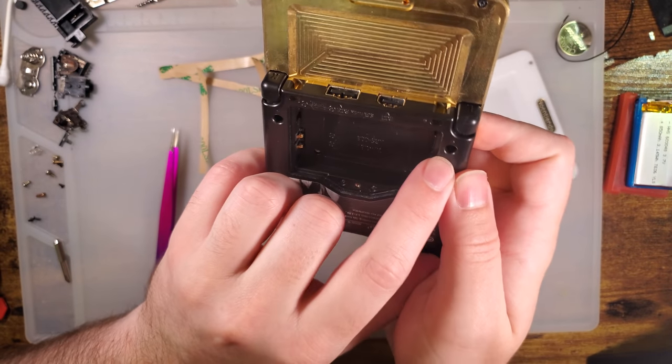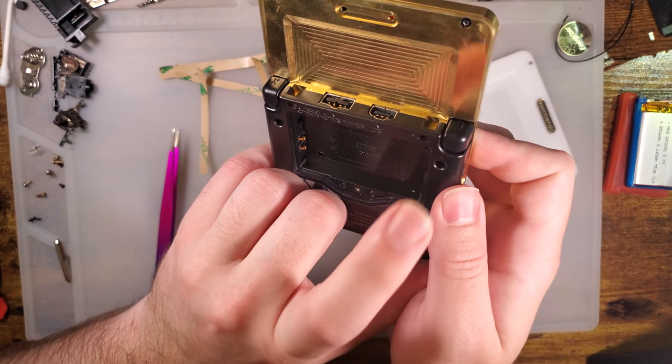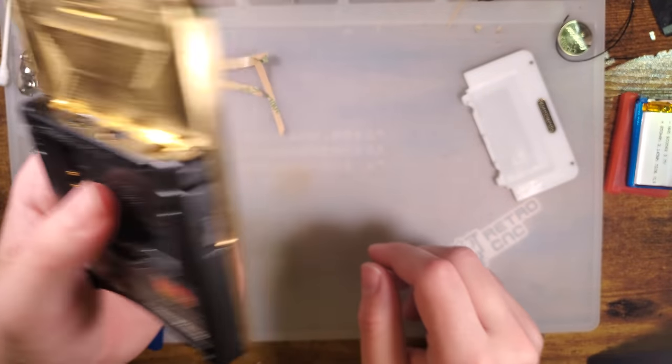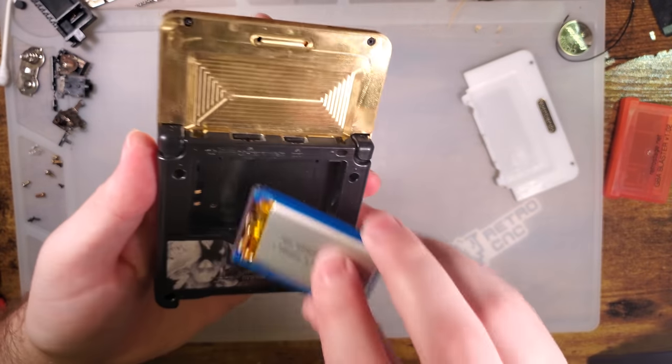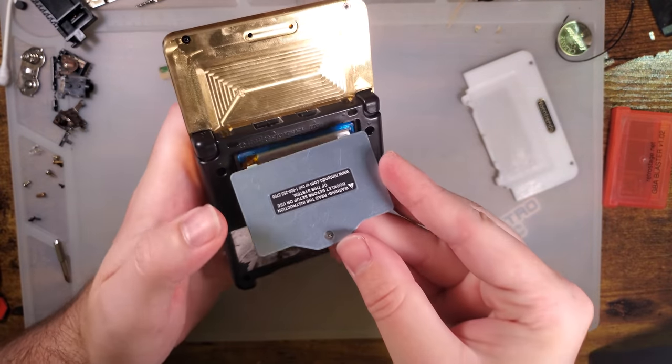If you use a long one in this corner, it will destroy your LCD. Do not use a long screw in this corner. A short screw will go in, no problem. A long screw will go in and give you a big problem.